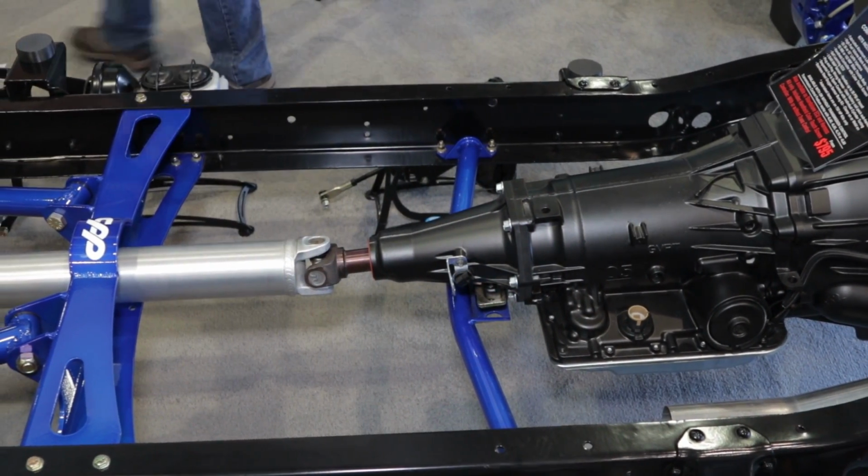But let me tell you, building this Chevelle next to us, we built it in a week. We put the engine in away from the firewall, slid it back towards the firewall to see where things were going to fit. We knew that we had to make some adjustments around the coil pack and the heater core. Slid the motor forward, put in the flex plate and torque converter, brought the trans up, slid the motor back into the trans, bolted it down, slid everything forward, brought the exhaust up, slid it back, started doing the plumbing and the fans in the front of the motor once we knew where the motor could fit.